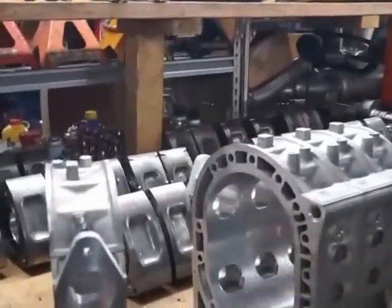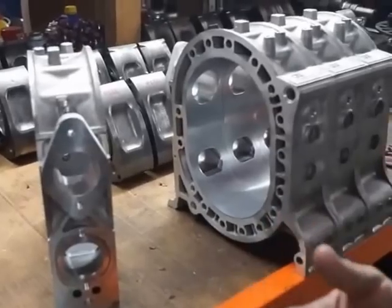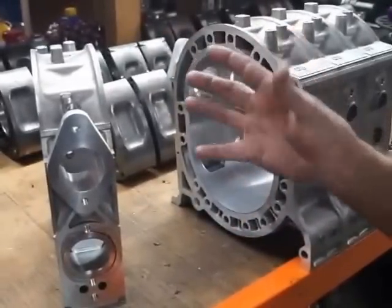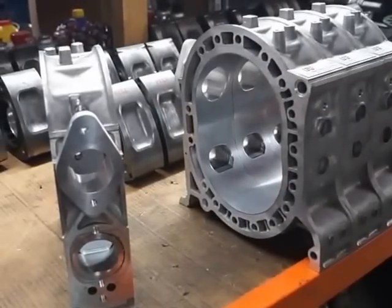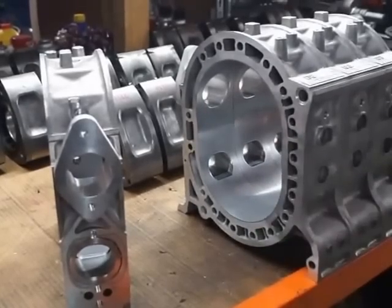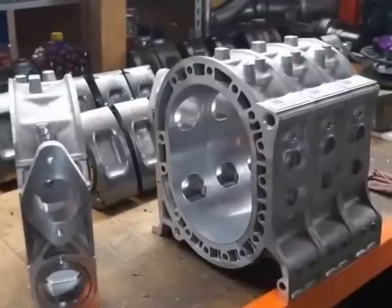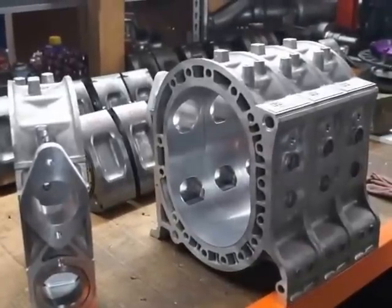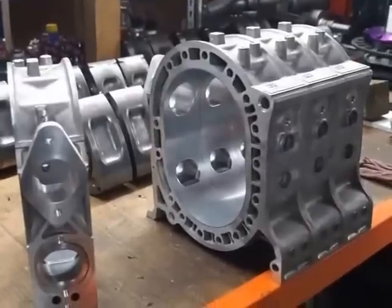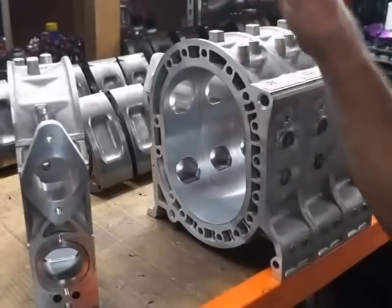The whole idea is to create a vacuum as the exhaust is pulling on the intake through the rotor pocket — to create a vacuum in the exhaust system where it actually pulls more mixture than the total swept volume of the combustion chamber — filling up the engine more and increasing the volumetric efficiency. We do that by the shape, the location, the port timing, and the shape of the bottom of the port. This combination makes maximum power and maximum torque at about 7800 RPM, makes excellent power all the way through about 9800 RPM, peaks out at about 9400-9500, stays flat to about 9800, then begins to taper off.